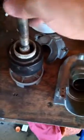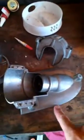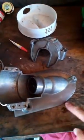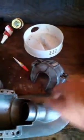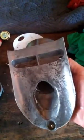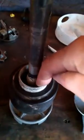And a lot of times what happens, there's 3 things that I know about these skis that happen. The water will either leak in underneath this, around here somewhere. So this would have to be pulled off and resealed underneath with the 5200. Or the water is going in through the seal where the bearing is and then pouring out the front of the bearing.